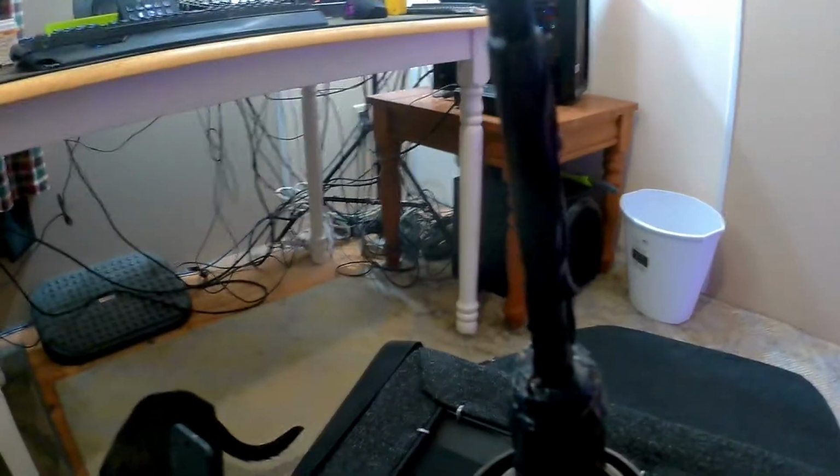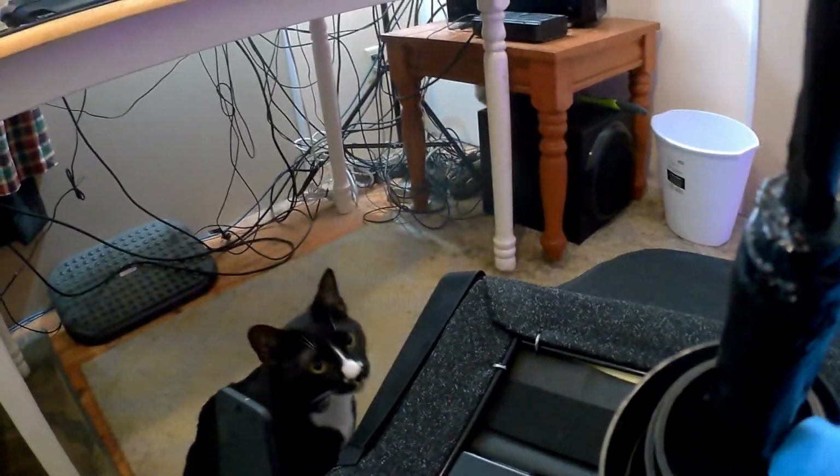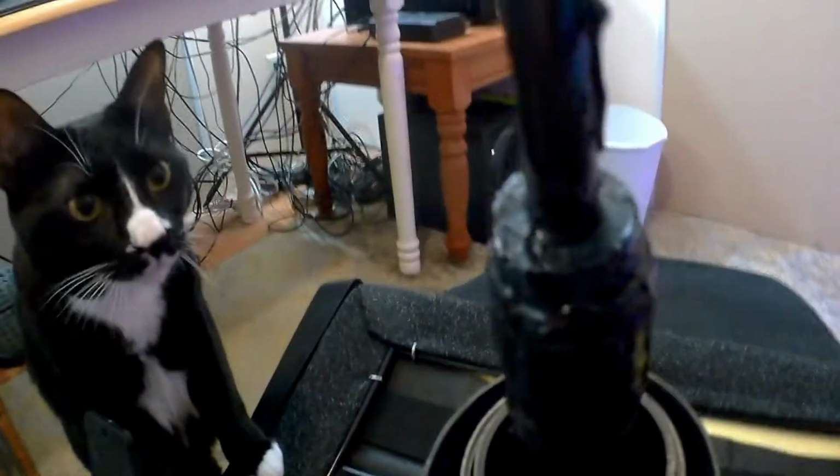All right, so after you put all the grease up on the shaft and you lube all this up and everything, sometimes this cone is kind of stuck upwards. Push it down so you expose all the thicker shaft here, and grease up all of that too. Just be very generous with the grease. Give it a lot, okay?